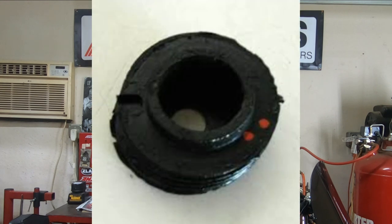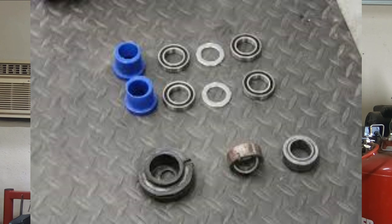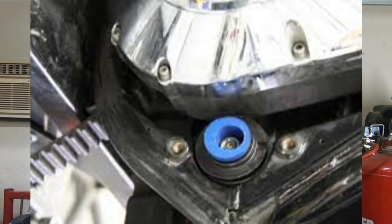Now, aside from just your motor mounts, you also want to check out your swing arm bushings. I know there are some aftermarket companies out there that make polyurethane bushings and motor mounts, but man, I tell you what, I know they last a long time. They're very rigid. They work great. The bike will handle great, but it's going to shake your teeth out even worse than it already does because you're taking out the dampening. Those polyurethane bushings are great. They're very rigid, but they damn sure don't dampen like rubber. The bike will handle better, but you gotta give something up for something.